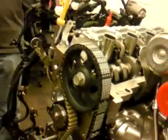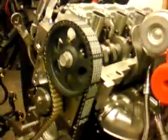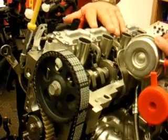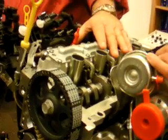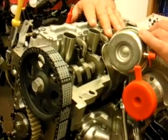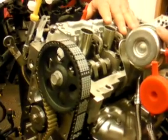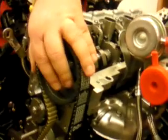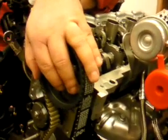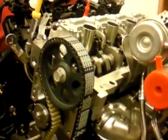Now the other thing is, every one of you is going to do this — you're just going to put an air wrench on there and tighten her up, right? It's not a high torque bolt, 88 foot pounds. My air wrench does that. Every one of them I have seen tightened with an impact has worked loose. I cannot explain it — it's like the old 540. I think it has to do with the gear spinning on the shaft or something. Not that a 650 foot-pound impact wrench doesn't get it tight enough — put your 88 foot-pound torque wrench on it. When you all figure that science out, let me know.